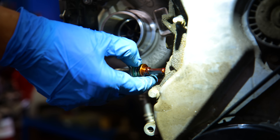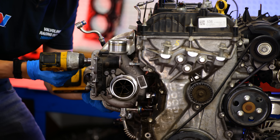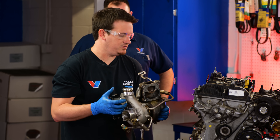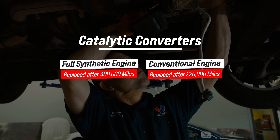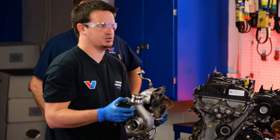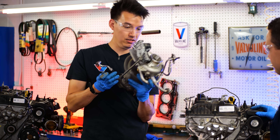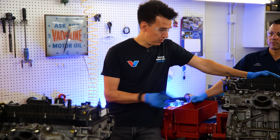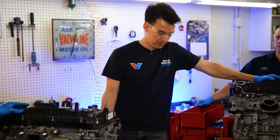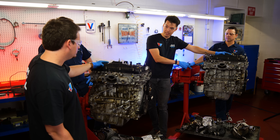The filter line looks pretty dark in there. Yours looks better than mine though. I think you're going to see a ton of varnish on the conventional, and I think the synthetic is going to be pretty clean. It's worth noting that these engines did not go 500,000 miles without issue — one wastegate actuator failed, and they both had catalytic converters fail. But at 500,000 miles, I'm surprised there's not more. Just took the turbo off and the side of this engine is much more oily. Your engine looks like it has 50,000 miles on it and this one looks like 150. One had a front seal leak which explains how oil got flung back here, and the other had a rear main leak.